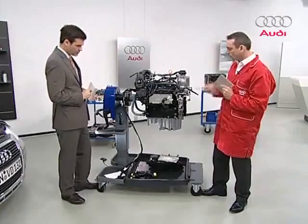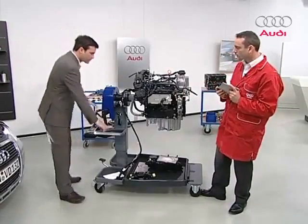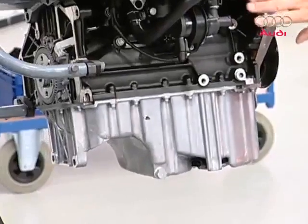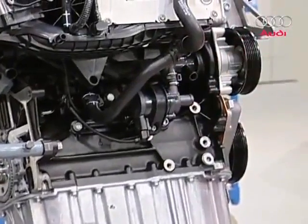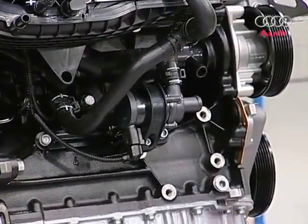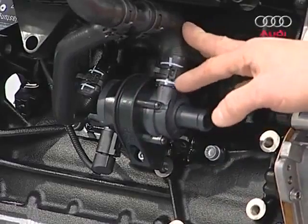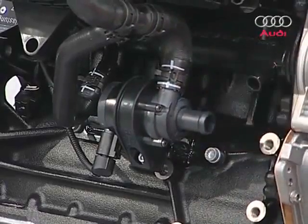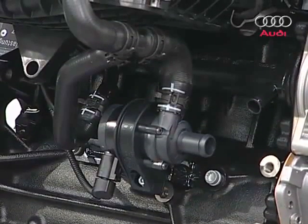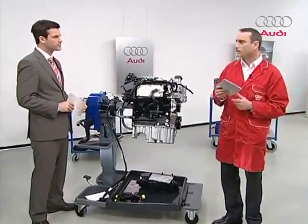The pump for the extra coolant is below the intake manifold. We know it from previous models and other engines, but now it acts as more than just a run-on pump — it also provides a self-contained coolant circuit. The charge air cooler is integrated into this circuit too. We'll examine it more closely later with the help of a special diagram.